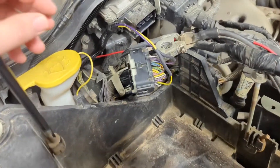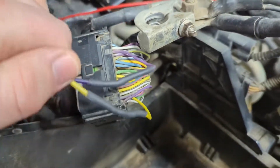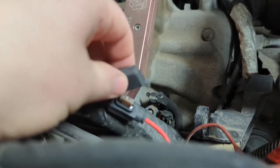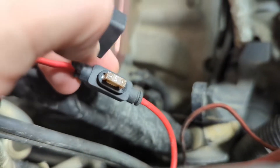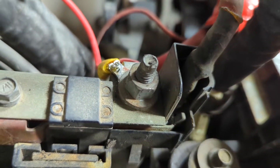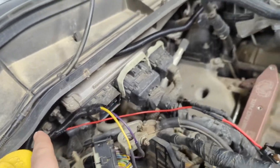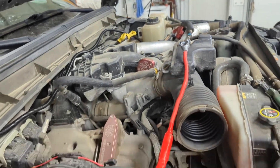Did a little fixing up here, and you can see the yellow wire is tied in and the purple wire is tied in to those pin locations. The red wire comes around — we didn't get on the load side of the fusible link, so we just put a five amp fuse with this little fuse holder, and then got it in right here for our 12-volt reference. We'll button it all back up, and the harness actually just has a little loop here, runs across — we'll tidy that all up over to the alternator.